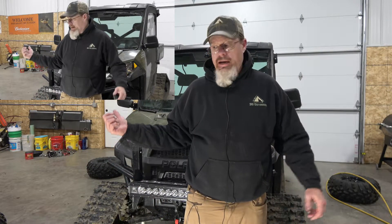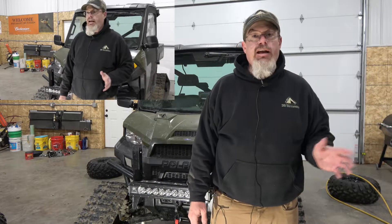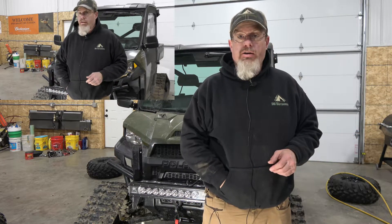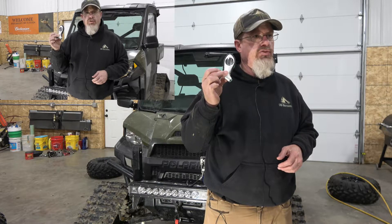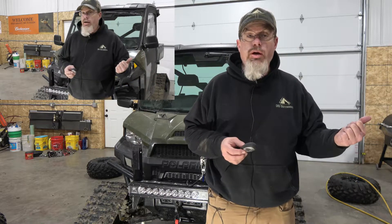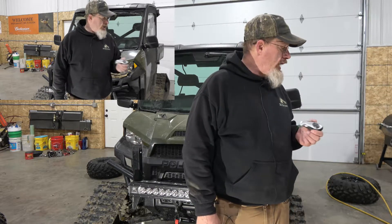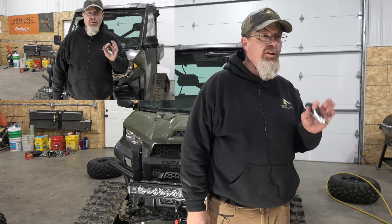Alright, time to get these tracks off and get the tires back on and ready for the trail. The tires are already laying on the floor here, and in my case I haven't had those on in several years. There's very little wear on them — they look fairly new. The first thing I did was aired them up, since the pressures were low. You're going to want a good digital air pressure gauge for your tires, because these are lower pressure tires — the fronts are max 10, the backs on mine are max 22. Pick up a digital tire pressure gauge so you can get the air set properly and know it's accurate, instead of those extendable ones that probably don't read very accurately.